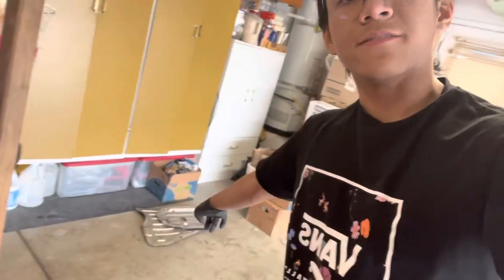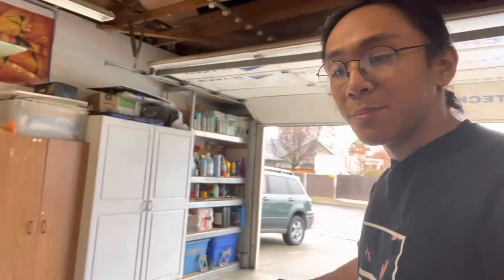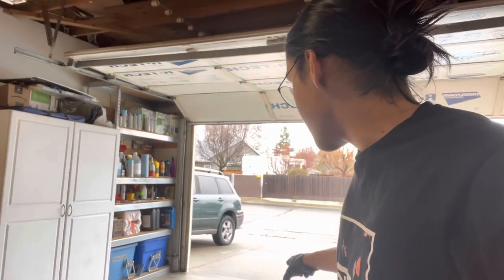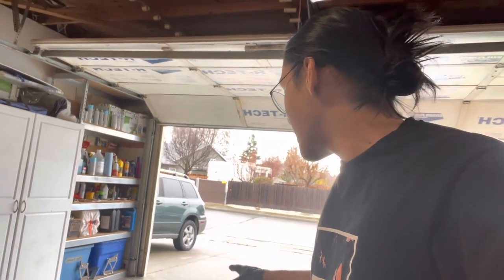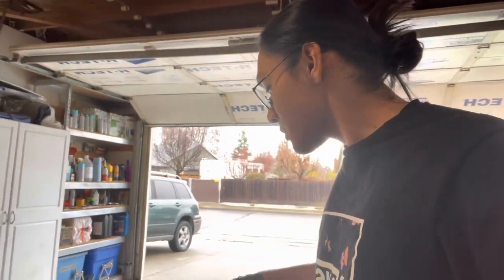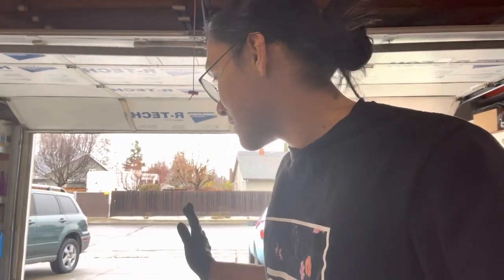Since the last time, I've removed the aluminum — I think zinc — plates and I've removed the clip hangers. I got the okay to cut the skid plate, so I'm going to start cutting to see how much clearance I can gain. Right now it sits about an inch and a quarter to an inch and a half depending on where you measure from the floor. I need to make sure the holes still line up. I took welding in high school but not plastic welding — I do have other ways to do it but let's hope I can just cut off enough material for this to fit.